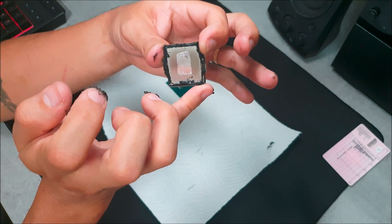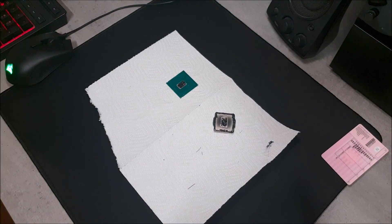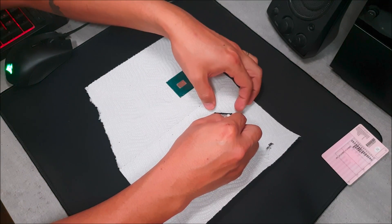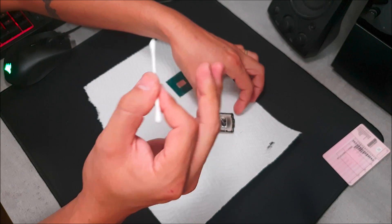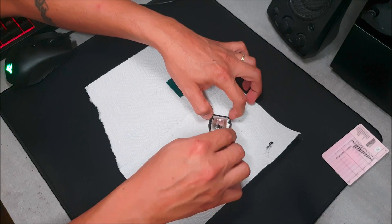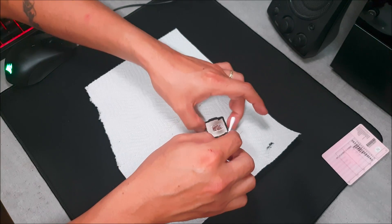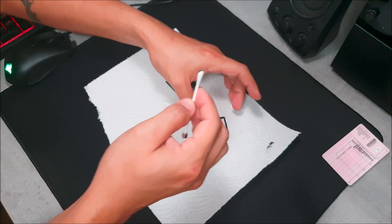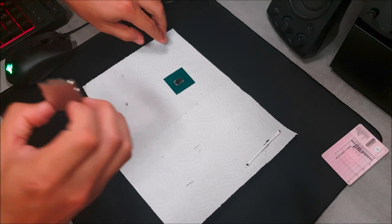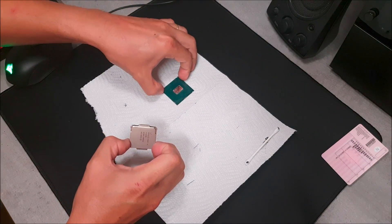The black stuff I'm using here is regular sanitary silicone — the kind you'd use on counters or in a bathroom. If you get something similar, read the instructions on the back of the tube, because it will tell you the temperature tolerance of the substance. This particular one, I believe, is rated to 90 degrees Celsius, which is pretty good. Above that it may deteriorate and lose its bond between the two materials. So pay attention to that detail.